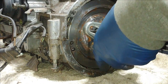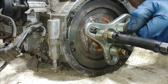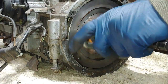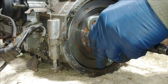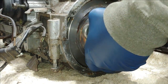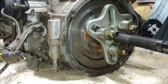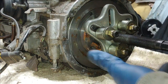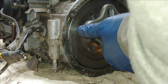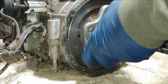Check clearance and then look down from the top to make sure the back surface of the puller is parallel with the flywheel face. That way you get even pressure all the way around, which makes it much easier to pull the flywheel off. Spin the flywheel to verify even pressure, then snug everything up and tighten the bolts a little.